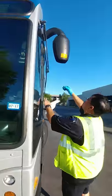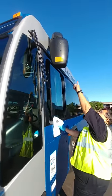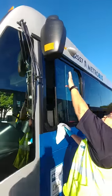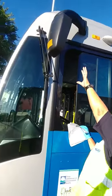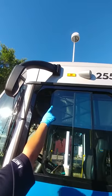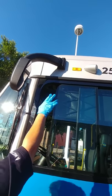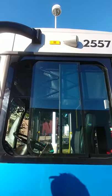Got my mirror over here, making sure that the mirror casing is properly mounted and secured to the bus, and that my mirrors are intact and free from damage. I have two side clearance lights here, making sure that they are amber in color, securely mounted, and free from damage and debris.